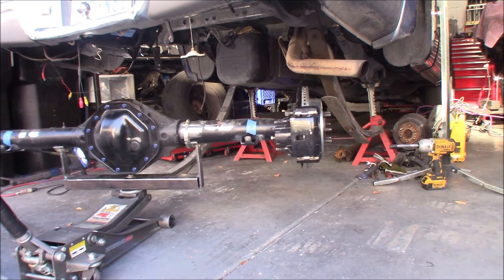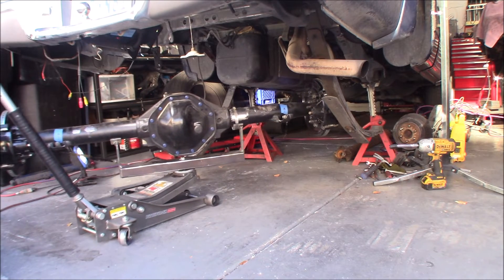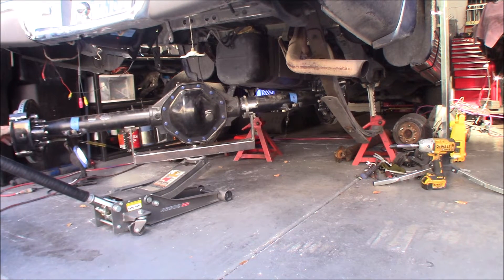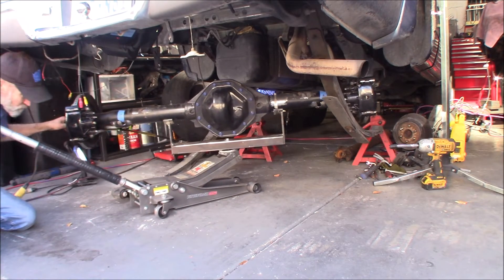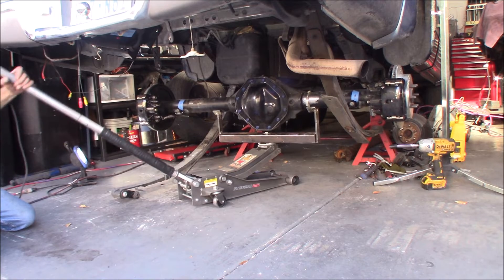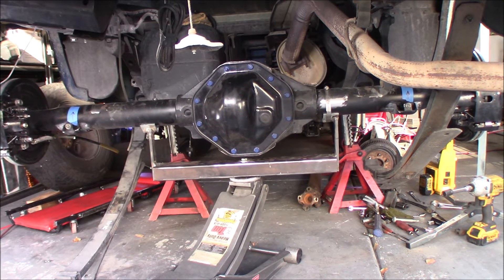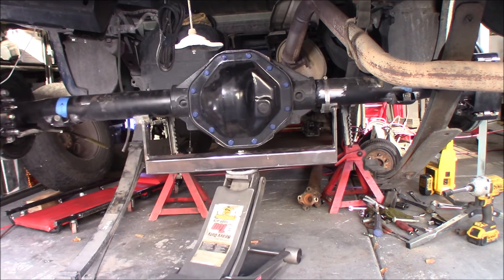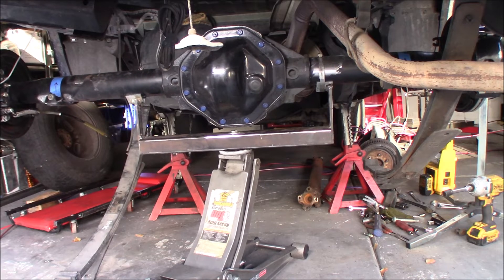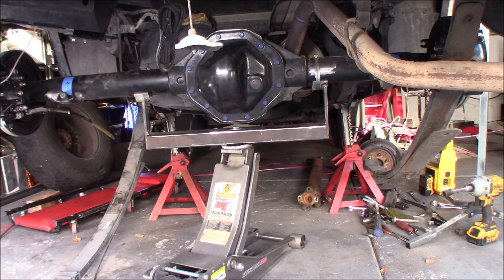What I can do is spin this like so, drive it right in here, take it up a little bit, just like that, then turn it toward my light — like that. Now we can raise it up. This would sure be nice on the really heavy axles, like one-ton and three-quarter-ton axles. As you can see now, it would be easy to reinstall the leaf springs.